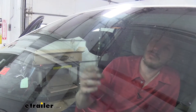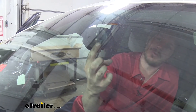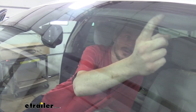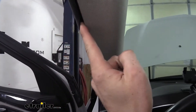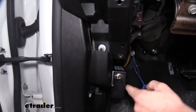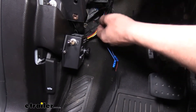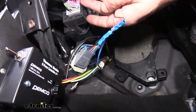Lastly, we'll mount our LED indicator, which sticks right here on the back side of the mirror. Make sure you avoid any sensors when sticking it on — just peel off the adhesive backing and stick it into place. The wire we poked right up into the headliner, ran it all the way down to the edge of the window, pulled back just a little bit on our A-panel to poke the wire in, and then tucked it in the weather stripping going all the way down to the lower kick panel area, poking it up through openings so it comes out right behind our control unit.